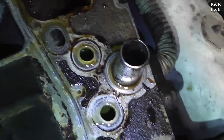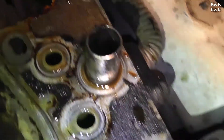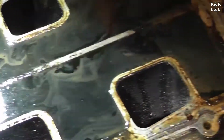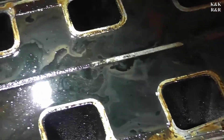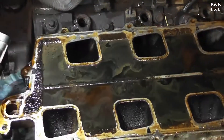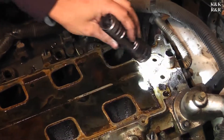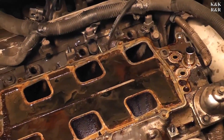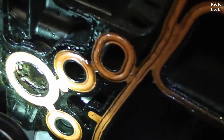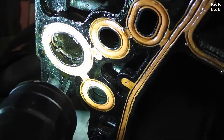Let's take a look at the intake. You can see the water was literally going down — there's the hydrolock. All that's got to be cleaned up. This is the problem area; it all has to be cleaned up thoroughly. Once this thing got full, the gaskets gave way, and that was it. That's coolant — there's a little bit of carbon in there, but that's coolant, people. That should not be there. That's the EGR pipe. The leak is right here through this area — you can actually see the crack right there. It's blowing right up the EGR tube under pressure.